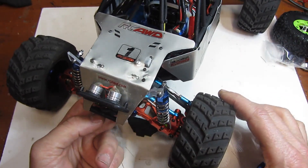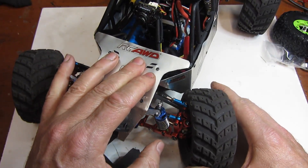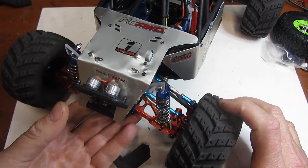I'm going to try to put this right back on the stock hub adapter, and as you can see I can't actually get it all the way on because it's hitting the steering linkage right here on the inside. The wheel is just too big, too wide, and even if it did fit, if I turn it all the way and load up the suspension it's actually going to hit right here on the body. So to solve that, what we need is a hub extender.